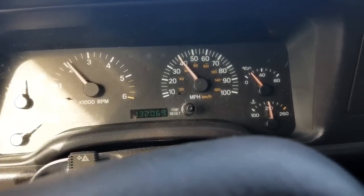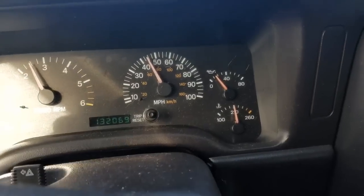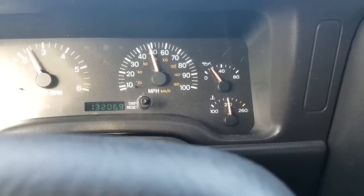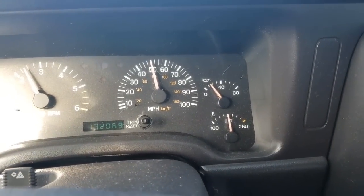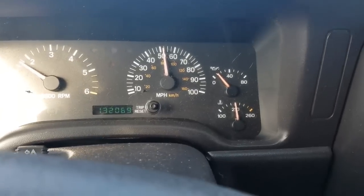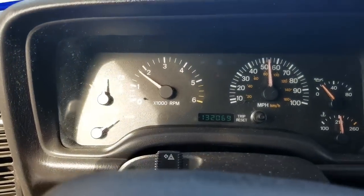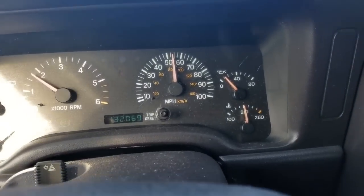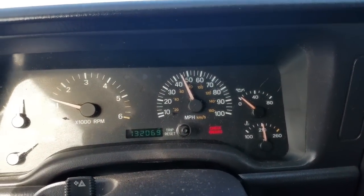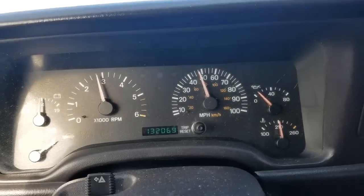We're driving around today and I've noticed that my oil pressure gauge is running fairly low. Over the last few days it's been dropping — it fluctuates down to zero when it's at idle and will jump up to 40. Normally it would stay around 40, jumping a little bit higher when accelerating. If I let my foot off the throttle, it turns on my check gauges light until I start accelerating again and it picks back up.